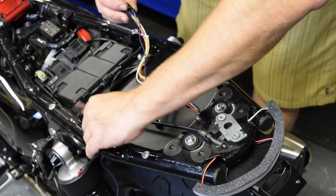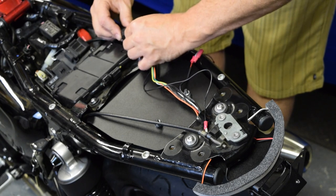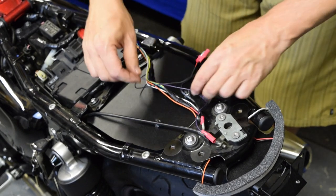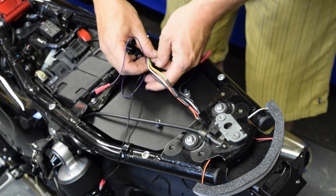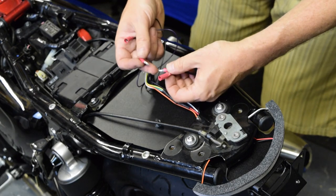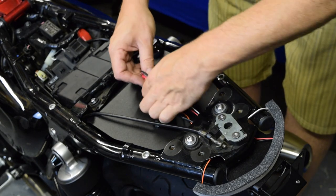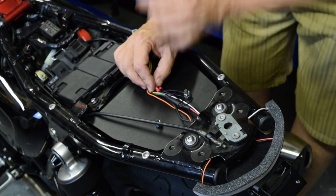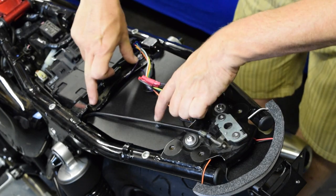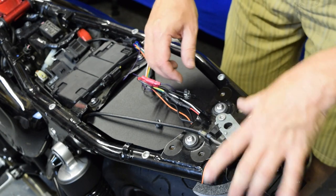This really is plug-and-play. The plug can only go in one way, so just push that in until you get a little click and slide it back onto the battery box. Then you've got these two spare cables for the rear number plate light — they're male and female bullets so they can only go together one way. Push those together and that should be that. I'll probably just zip tie these with a little plastic over that just to add extra waterproofing. It's also a pretty straightforward job to unplug these, undo those bolts, take it off, and put the stock one back on.